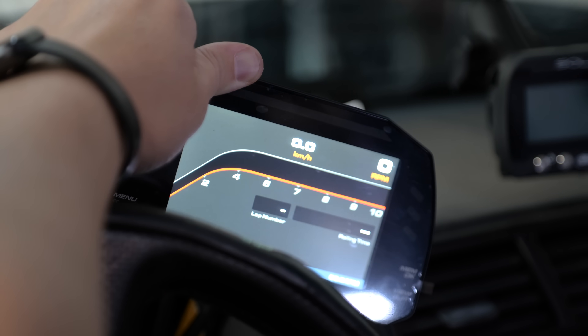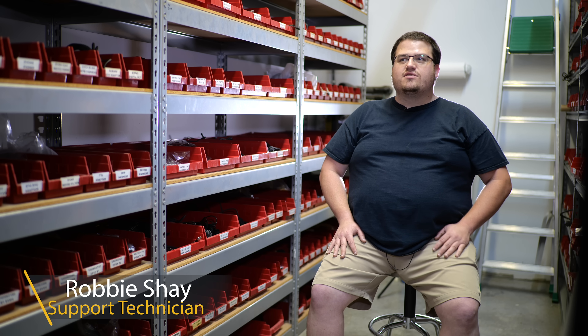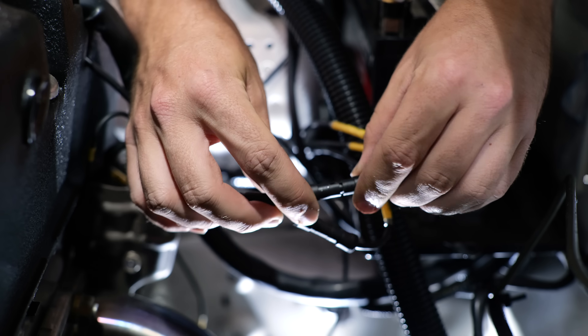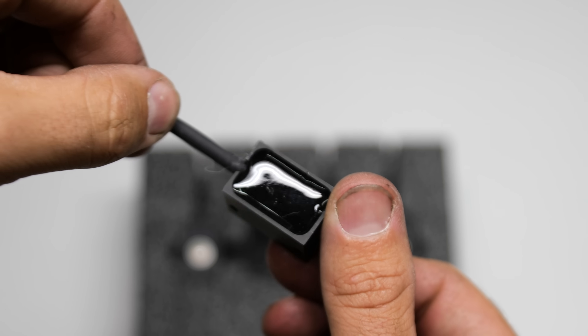Now it's time to add some new sensors to the car to read information that I couldn't see before — things like oil pressure, GPS speed and position, and even tire temperature. With Mia, we're adding a couple of different sensors with room to grow. We sourced a two-in-one oil pressure and temperature sensor from KA Manufacturing — they do automotive specialized sensors. You're measuring vehicle health with that sensor. We've also added tire temperature sensors, which relate to the core of everything suspension. Tire pressure and tire temperatures are two major things for every high-level racer, and any suspension adjustment you make is going to affect your tires.